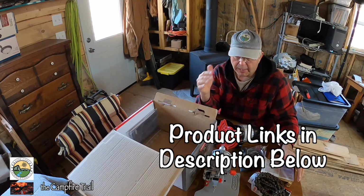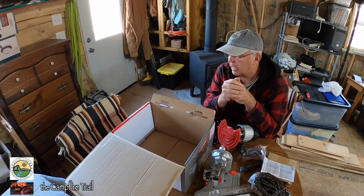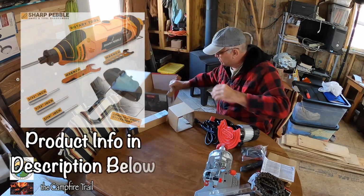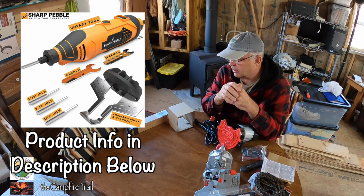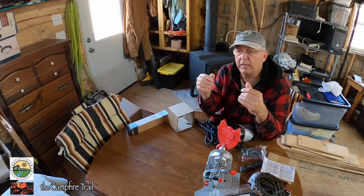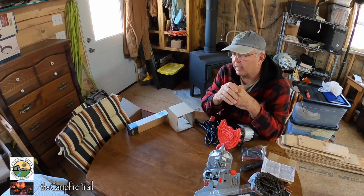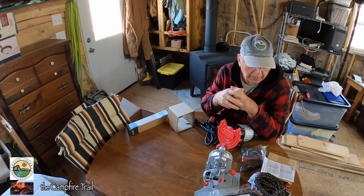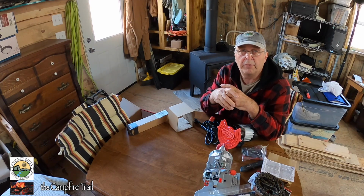This is a big grinder type, and my uncle, as I was looking at these things, used to have a chain sharpener that was almost like a Dremel tool with a little cylinder shaped grinding wheel on it. He learned to sharpen chains pretty good with that, but in that learning curve, he burnt a lot of chains with that grinder just by doing too much at a time, and it would turn the teeth blue, and then I guess they would lose their temper, and they wouldn't hold an edge that well. They're a lot cheaper, so I'm going to put a link on one of those down below here as well.